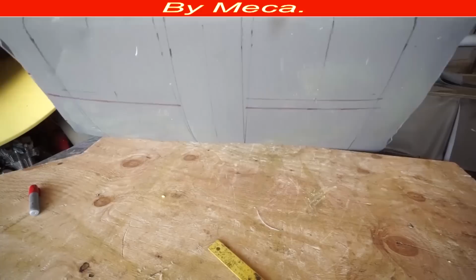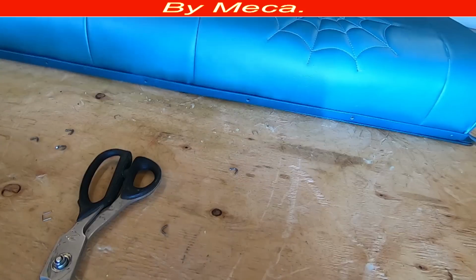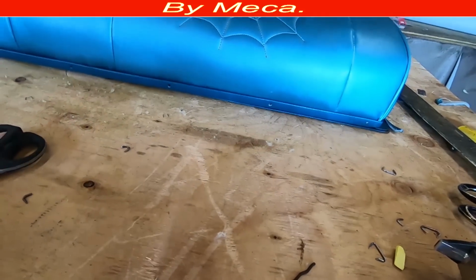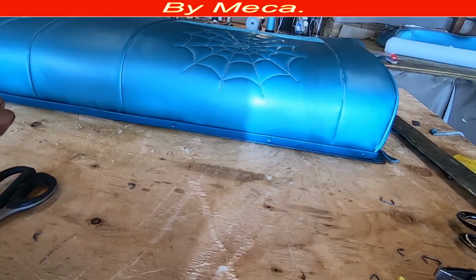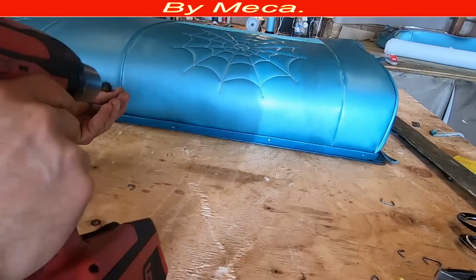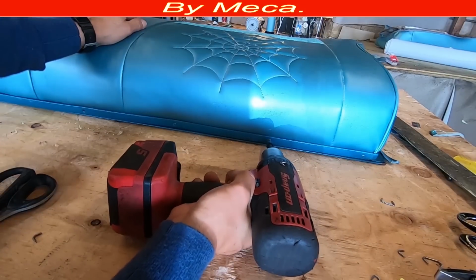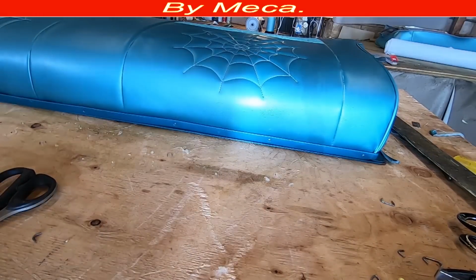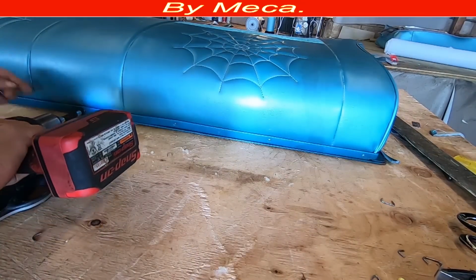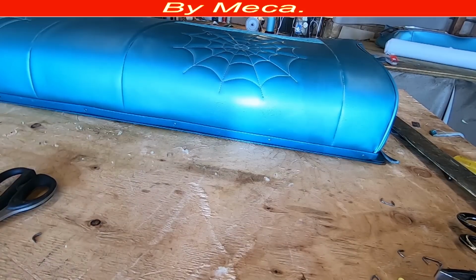Like I say, I didn't make the whole foam new, but I repaired at least 80%. I didn't change the other 20% because it wasn't necessary, believe me. And I got the backrest in there. You can see it on there. This goes with a staple all around, and there is a molding on top. I had to put the molding with Phillips screws, and that molding goes all around except on the bottom. If you are learning about upholstery, don't use a wireless screw gun to put this kind of screw. Do it manually. I recommend you do it manually, learn manually.